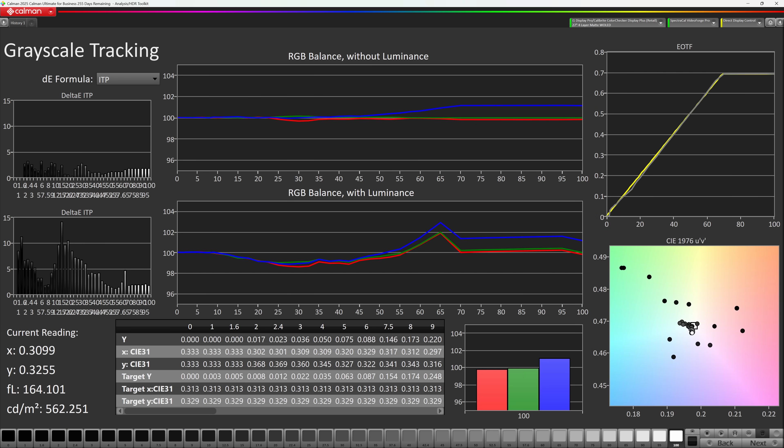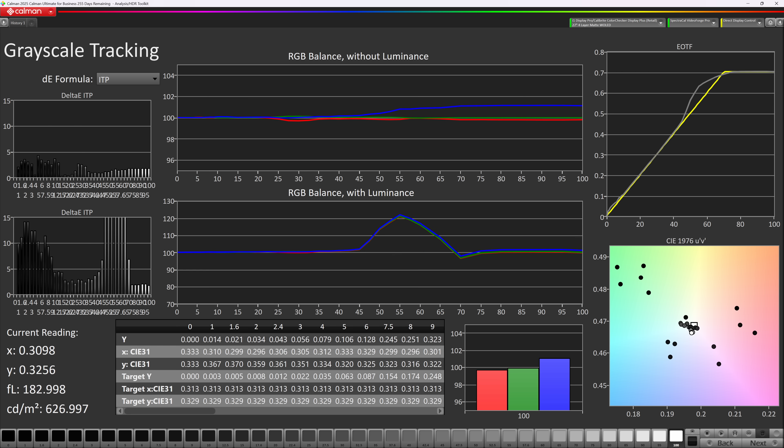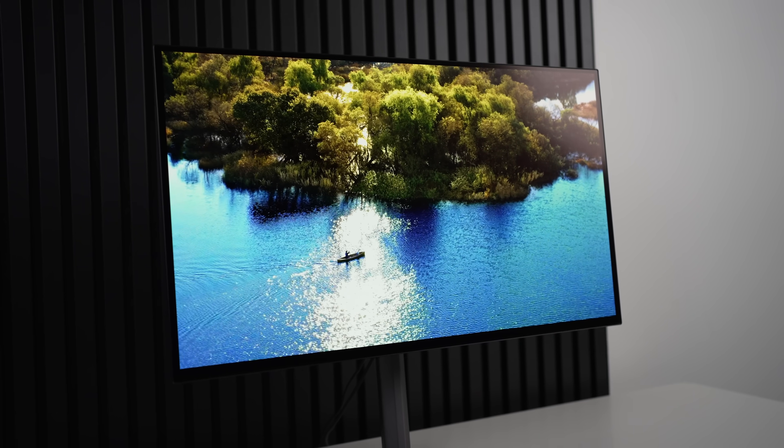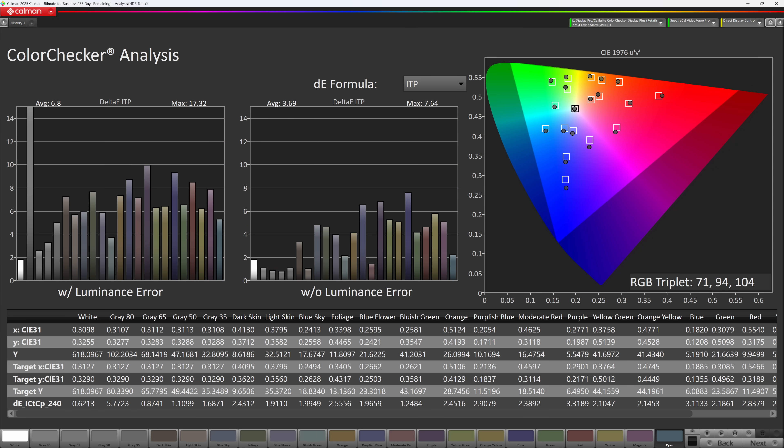When it comes to HDR, it's not quite as good. In the default HDR, the RGB balance is pretty good overall, but the other modes are where it gets worse. The HDR game mode has some blown-out highlights. The HDR movie mode unfortunately slightly under-tracks. And the HDR Peak 1500 mode, which should be the brightest mode, also has some blown-out highlights. Pretty much all HDR content on all these settings had some issues with accuracy when it came to brightness — something going on with the automatic brightness limiter. However, the color checker analysis for HDR was decent with an average Delta E of 3.69.